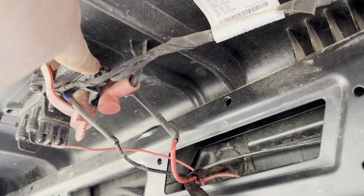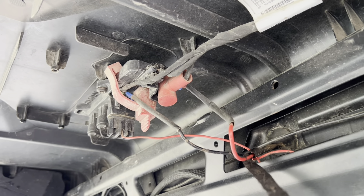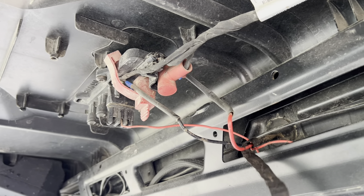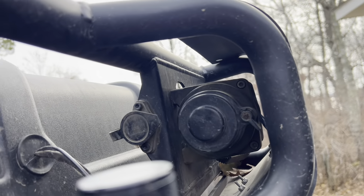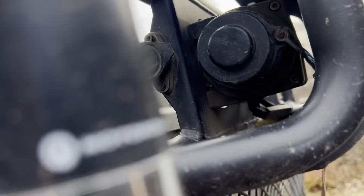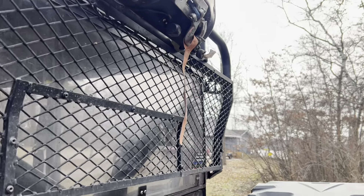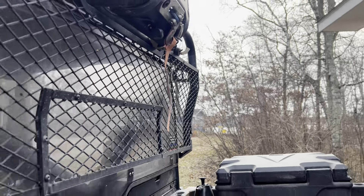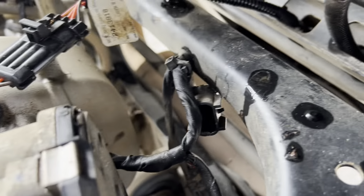There's my rear bus bar. This wire right here on the bus bar under the hood is the one you tap into. I didn't cut it — I just tapped into it, so it will still work with the key as well as the switch. Coming out of that wire I have the wiring for the little winch on my headache rack and then the wire for the camera right there. Now, controlling the camera — this is where it got a little tricky.